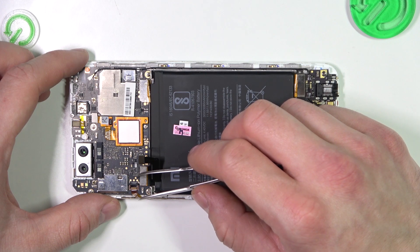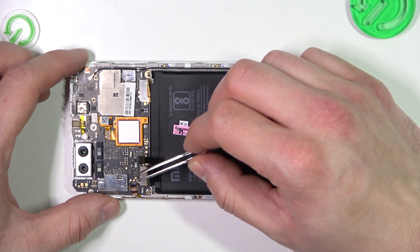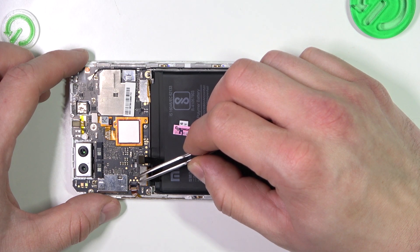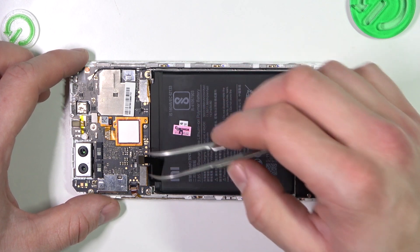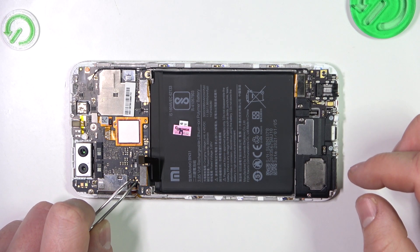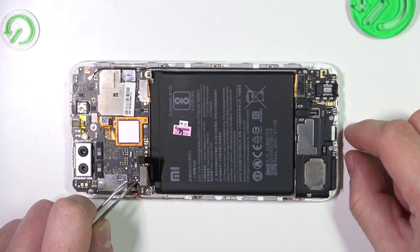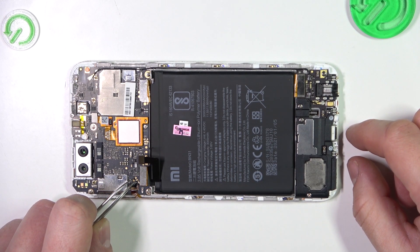This one and this one. What you are going to do is connect those two dots, and after they are connected, simultaneously plug your smartphone to the PC via the cable and then check if the Qualcomm is visible.